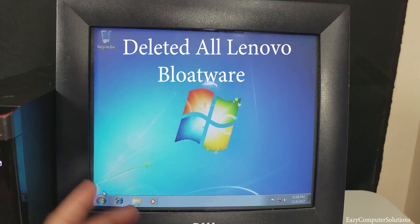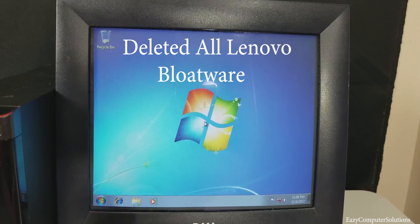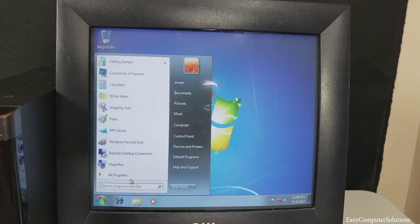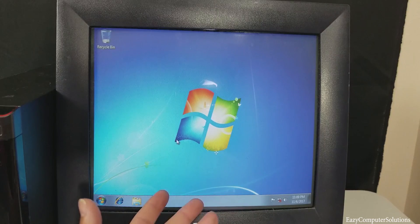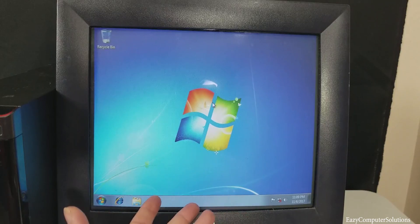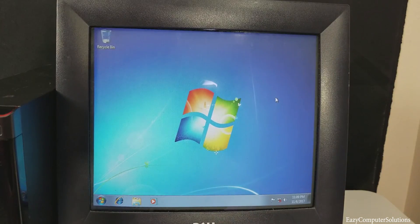We have a clean boot — we're done! I entered all the information and the install is fresh. Remember: I went to the Lenovo website, downloaded the ISO file, put it on a DVD-ROM, and did a fresh install. The computer is running great. I'd recommend the customer download Windows 10 — it has 4 gigs of RAM and an i3 processor so it's not too old. But my job is done. The computer wouldn't boot, I downloaded the ISO and got it fixed. This is Eric from Easy Computer Solutions — leave your questions below, see you guys in the next video, peace.